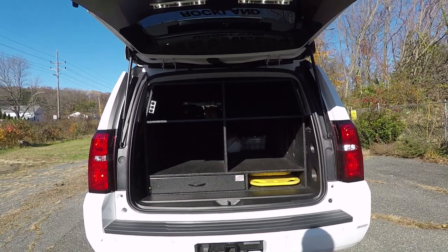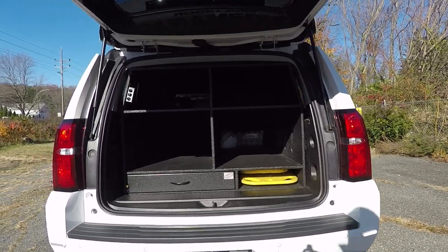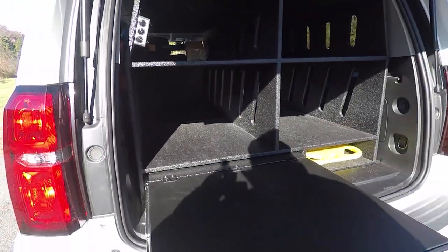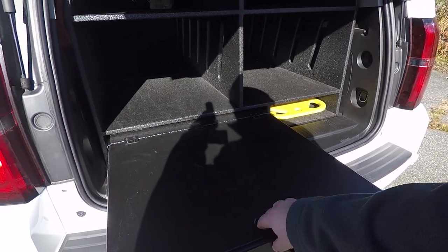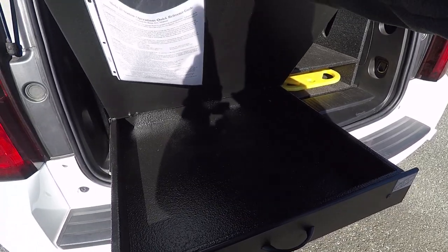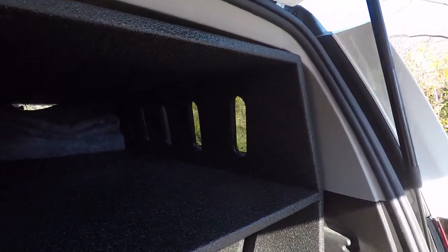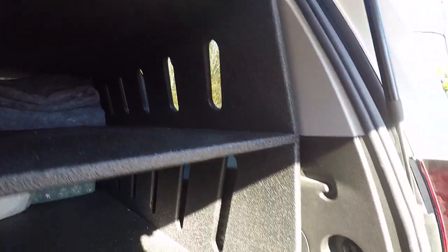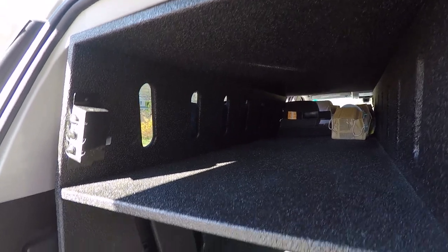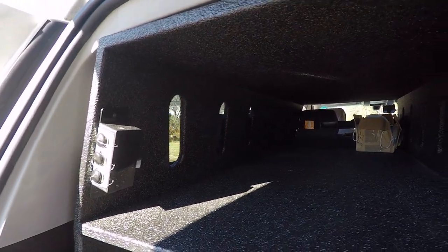What you'll notice with the cabinet is this is our paramedic style cabinet. It's got storage for backboards and then it also has a storage drawer for restocking. This restocking drawer has a work surface for them to work on and then it also lifts up and allows them to have storage of additional meds and whatnot underneath it. What you'll notice on all the sections of the cabinet is we've cut with the CNC vent holes to allow air flow to move throughout the cabin when the rear air conditioning or rear heating is on, to help prevent dead pockets of air inside of it.